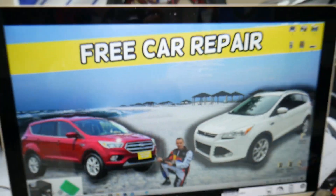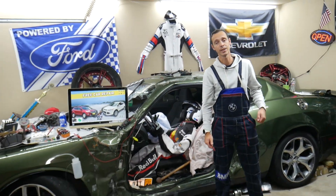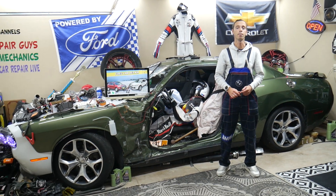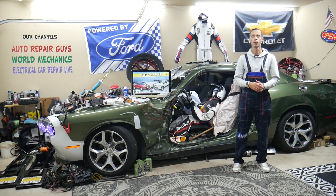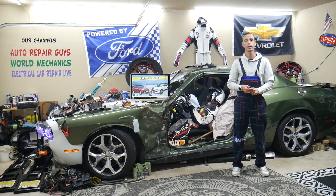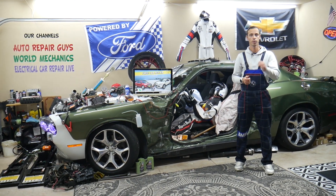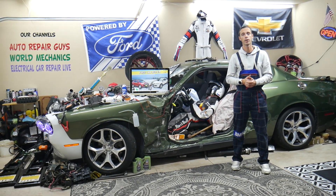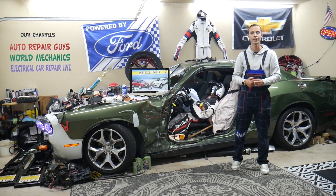If that doesn't fix the headlight, on some newer vehicles you may need to reset the BCM and clear the codes — that may fix it. We've had that happen quite often on newer vehicles if there was a problem with the headlight or if the bulb was disconnected, anything like that. Those are the most common things we see at the garage. Other things could be a headlight switch as well, but usually that will cause both headlights not to work. Hopefully this video will be helpful. Thank you for watching. See you next time.